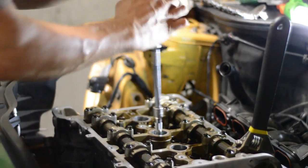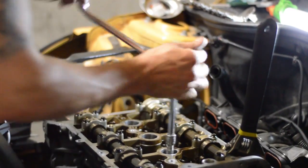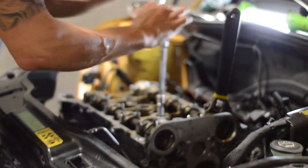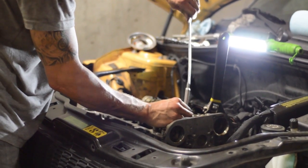We're also going to open up the exhaust. It has a full exhaust from the cat back, but the downpipe was stock, so we're going to replace the downpipe. We're also going to add a wastegate controller that will open the wastegate when 20 pounds of boost is reached.